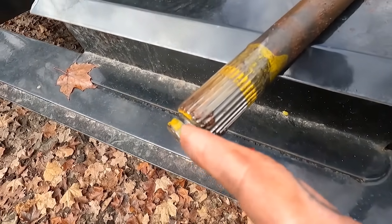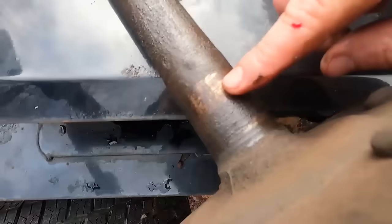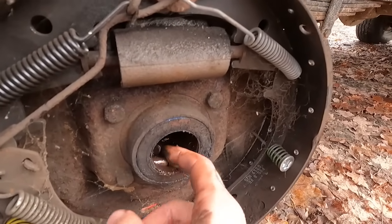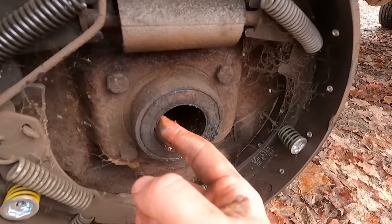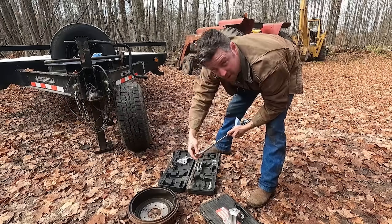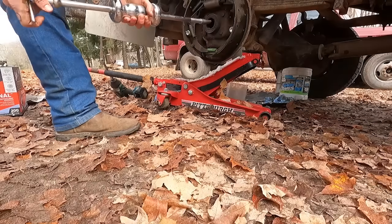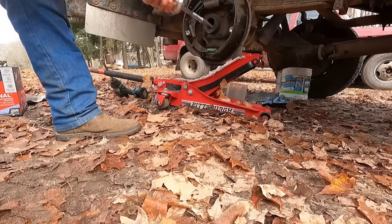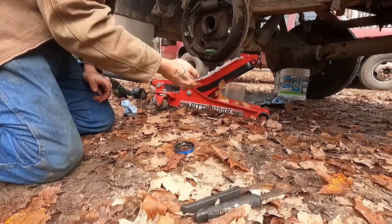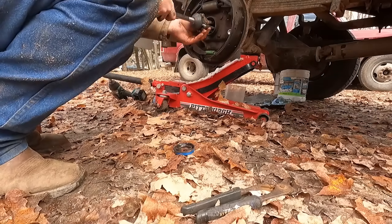Here's a better view of where that C-clip goes onto the shaft. You can see there's a little bit of rust from water inside there, and over here you can see where the bearing rides. It's just a little bit thinner, but I think it's in good enough shape to reuse — we caught it when we needed to. Inside here we've got our bearings and our axle seal. We're going to pull both of these out with a puller, using our slide hammer. This is a cheap Harbor Freight version and it works just fine if it's an only-every-now-and-again job.